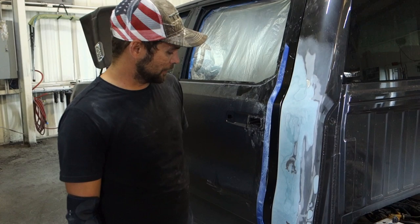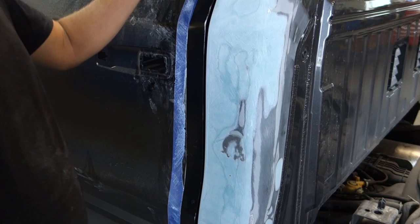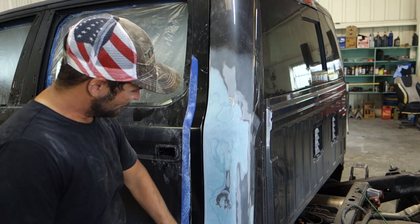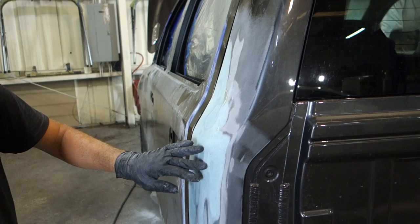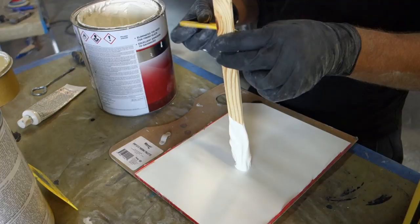This stuff is actually pretty hard. This is one of the first layers that I had left over, and this is not dry 100%. Alright guys, so after a lot of time — not the best at the filler work — but I'm done with the Dura Glass. I got my shape. I got my nice gap there. So now it's time to go ahead and use our lightweight filler to finish this and fill all the little pin holes and everything else like that and give it its final shape that we can prime in.